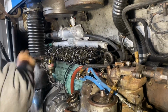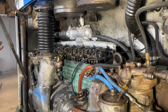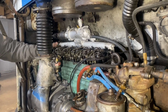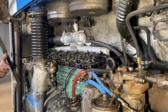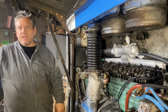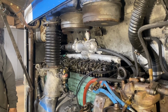Of those 55s, right? Yeah. That cylinder was definitely firing yesterday because when I shorted that out yesterday, it was like night and day difference. Yes. This one is still weaker than the others, but there was still a change with it. But on this one, I didn't see any smoke change, which if it's missing and the injector is firing, there's going to be a lot of unburnt fuel every time it fires. I thought there was a little less, didn't you? But it wasn't a lot. Yeah, it was just a very tiny bit. Every little bit. Yeah, if you combine 2 and 3, that might be the total of the smoke.